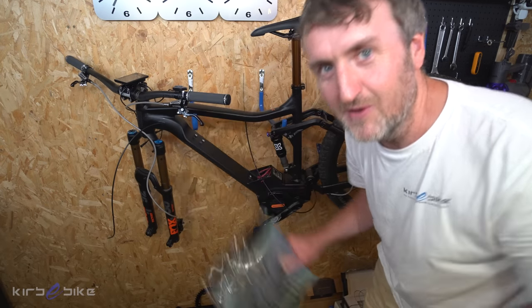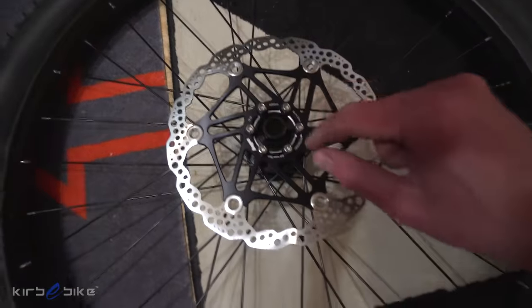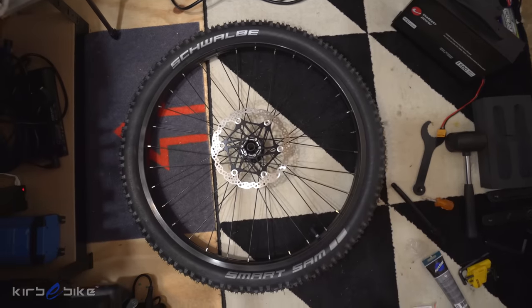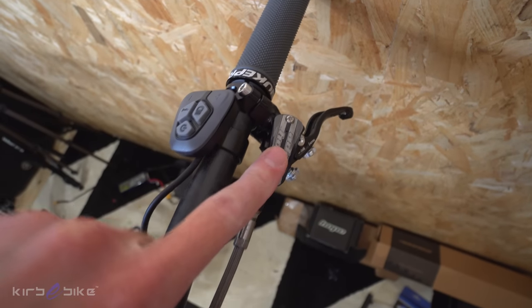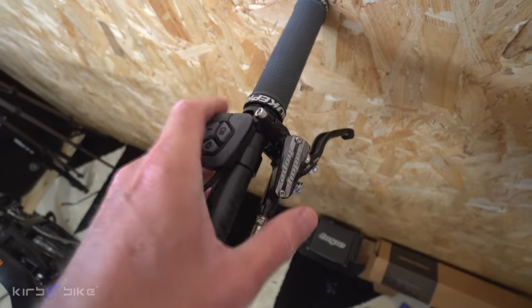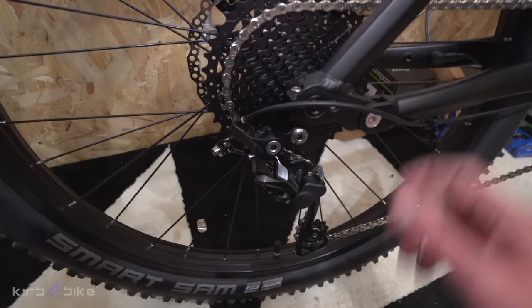Next I'm sticking this shiny new Hope disc on the front wheel — don't touch the disc. This is a very satisfying part of the build, just bolting things together. Discs and calipers are on looking sweet. Brakes have been bled, though I need a new diaphragm for one caliper as it's swelled up and not biting enough. Rear brakes are on too — needed spacers. The rear mech is on as well, no problem.